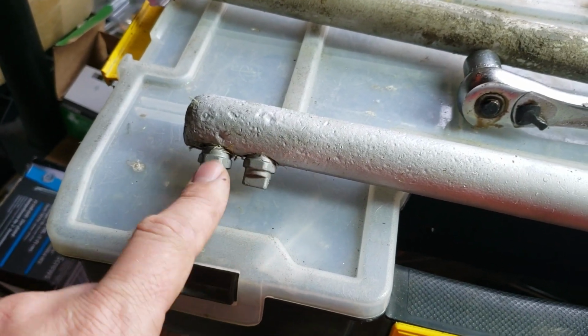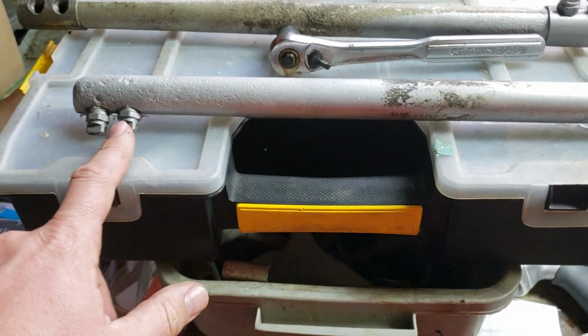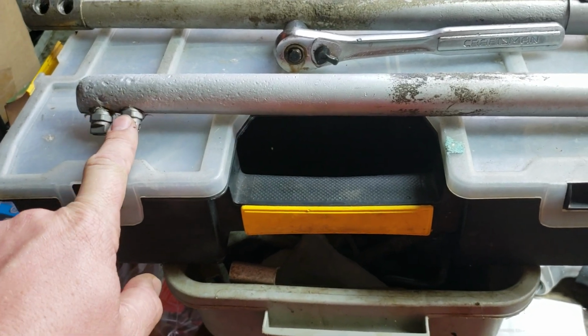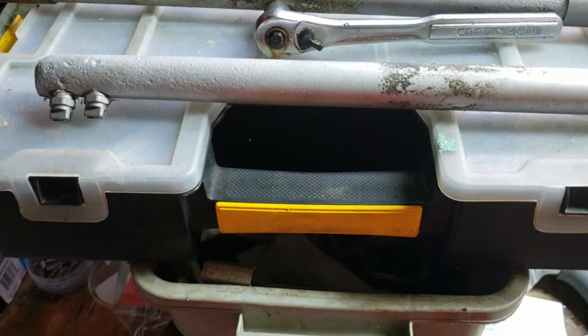Alright, so, did a little blow test. Those two are great. This one is good. This one is clogged. And so that will quickly turn over and cause issues. If this one is not unclogged, now you've got one jet versus two. This thing's going to shake like crazy.